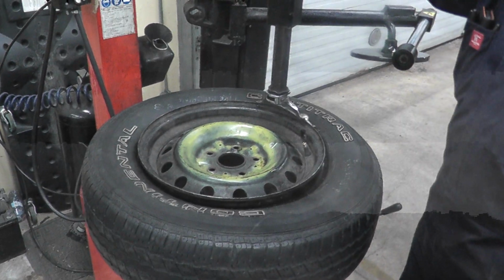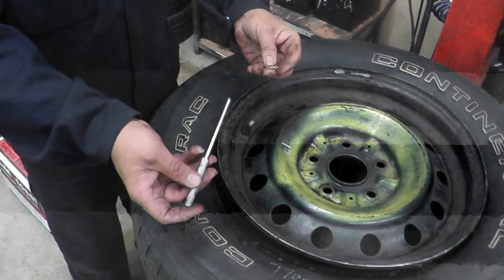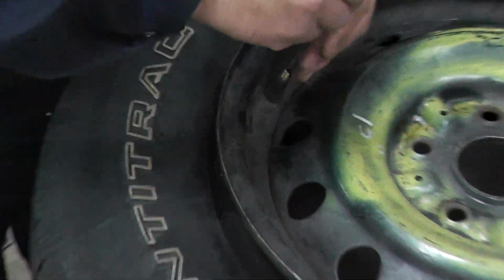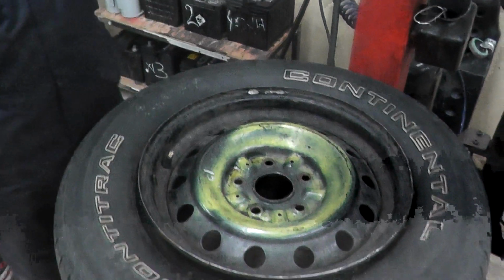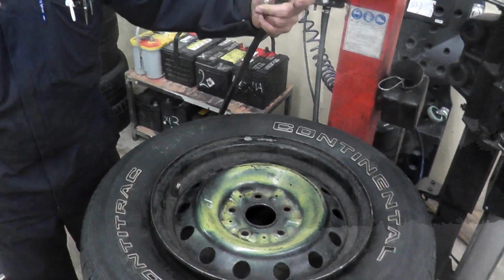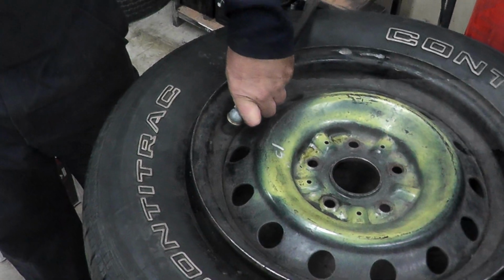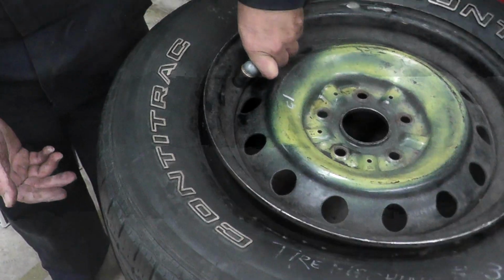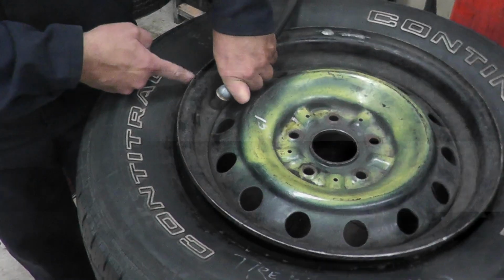We're going to move the duck head out of the way, unlock it, and move the duck head out of the way. We put the Schrader valve back in, same deal. Now we're going clockwise. Put the valve back in. Don't need to reef on it, just snug where it stops, just stop. We fill the air, so squeeze this, it locks on. There goes my compressor making more noise now. And then you press the pedal halfway. Okay, when you press the pedal halfway, I can hear the air coming out all around here.